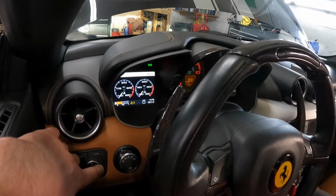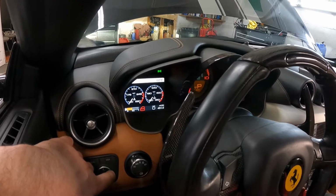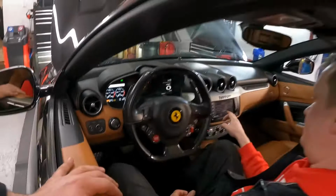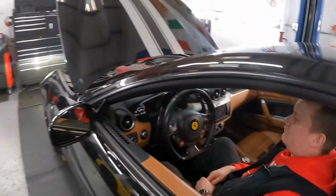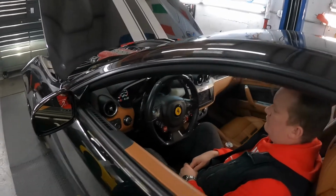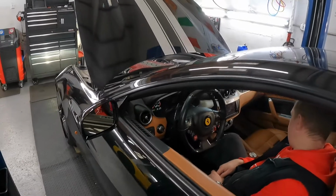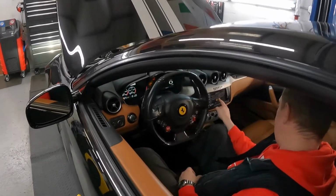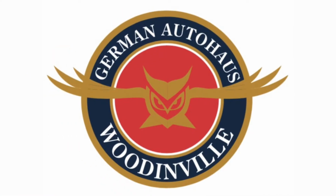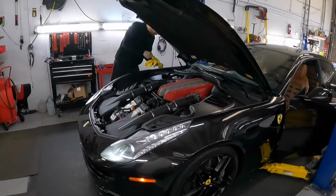Temperature, I think if it reaches 175, it will be fine. Yeah, we can start adjusting the level. And guys, on that car you can adjust the level only at idle and check the level only at idle. And first, then shut down and add it slowly. Almost complete. Just double checking it, making sure everything turns out fine.